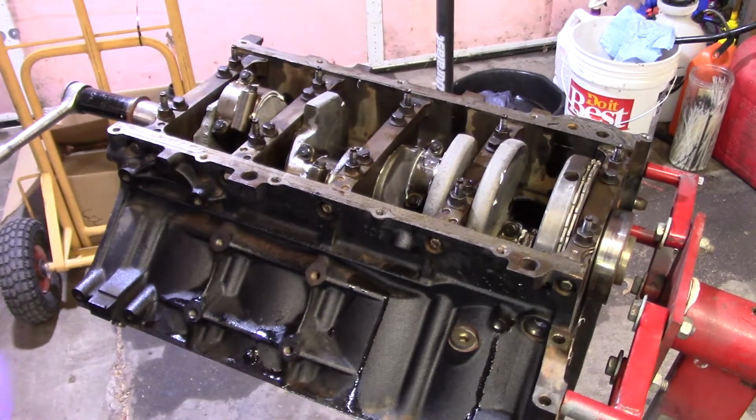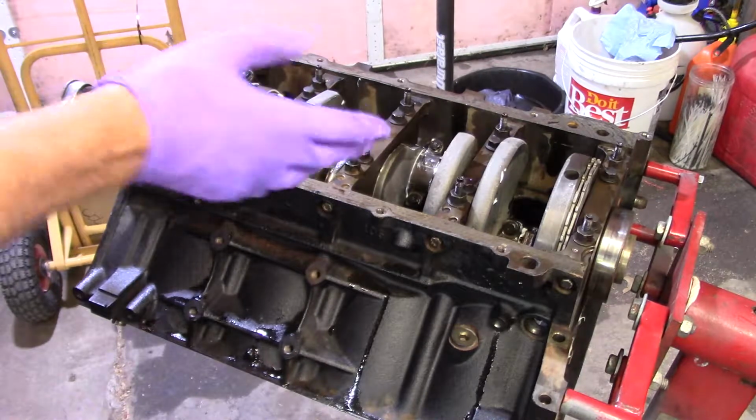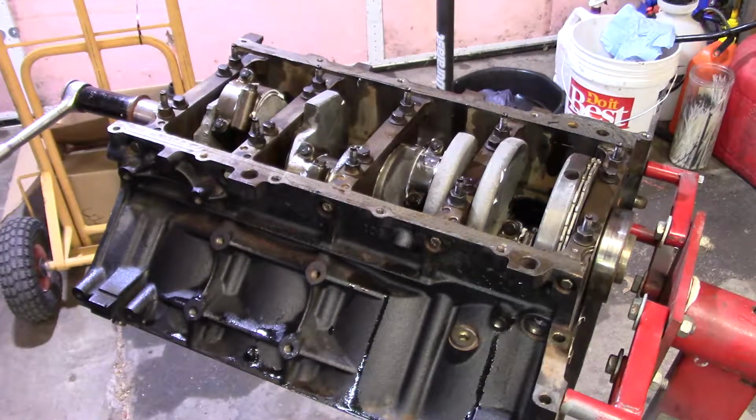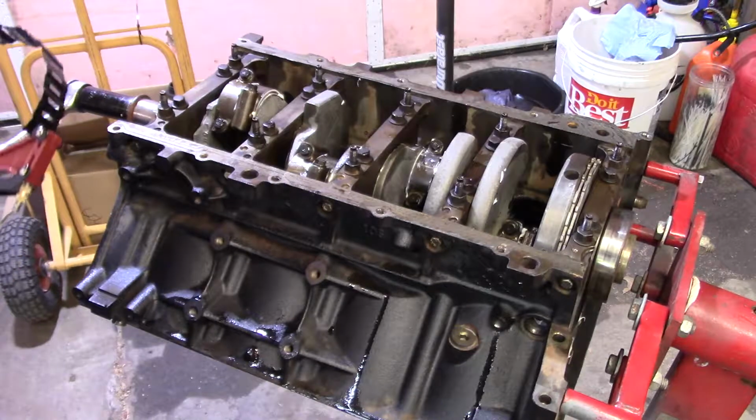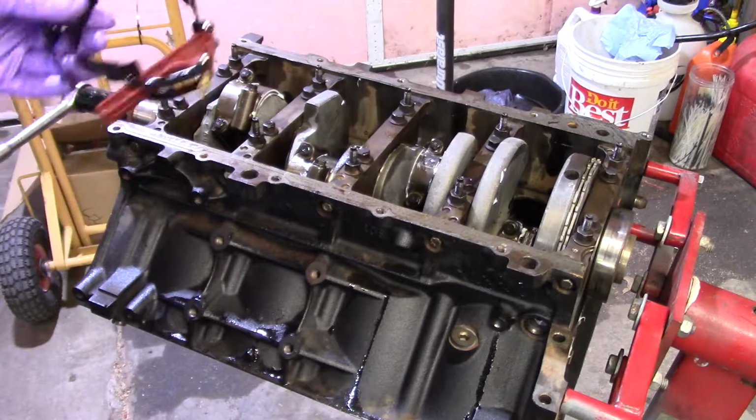Well, I kind of lied to you. I didn't show you torquing there. I showed you the first couple, but I didn't show you the 50, 60 extra degrees that was actually required to keep on going with those rod bolts. But I did want to tell you that the first three pistons, you saw the first two. The first three went good.